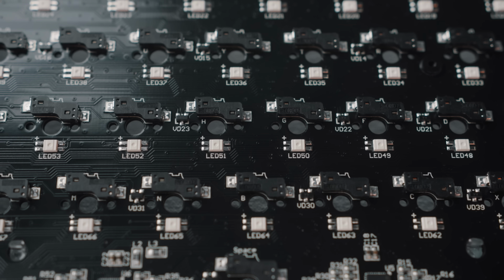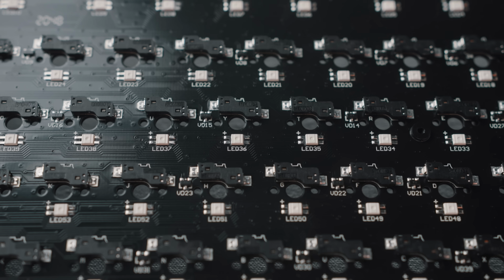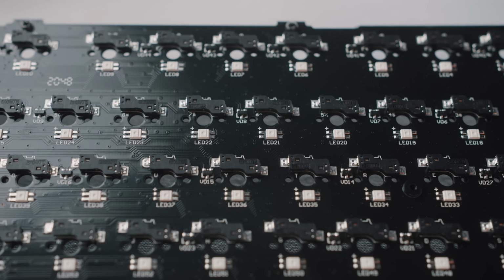Like the popular GMMK line of keyboards, the GMMK Pro only offers a hot swappable PCB, and it comes with their proprietary Glorious hot swap sockets, which from what I can tell don't seem functionally superior to other existing hot swap sockets at the moment, other than the fact that these Glorious sockets are orientation agnostic in terms of installation during manufacturing.